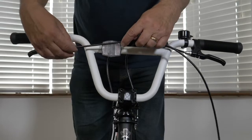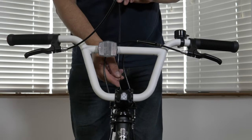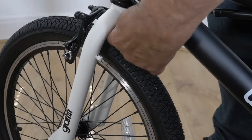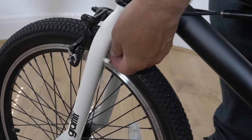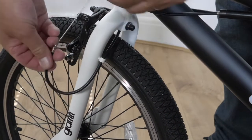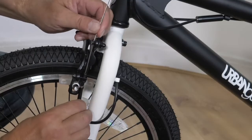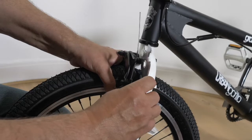Attaching the front brake: feed the brake cables over the handlebars, then feed the front brake cable into the channel on the top of the handlebar stem until the brake cable feeds out of the bottom of the fork bridge. Then feed the brake cable through the brake boss on the front fork. Feed the brake cable up through the caliper brake cable guide, then through the cable pinch bolt. Hold the brake cable in position and tighten the caliper pinch bolt.